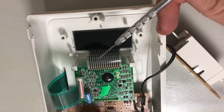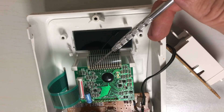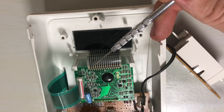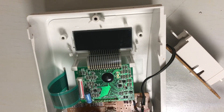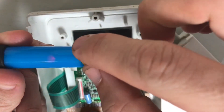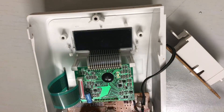These carbon traces in the ribbon cable are applied with heat and pressure during manufacturing. I've read that bonding starts at 180 degrees Celsius. I've got a soldering iron that I can turn down to 200 degrees Celsius, so that's what I'm going to try — just apply a little bit of heat to get a better bond.